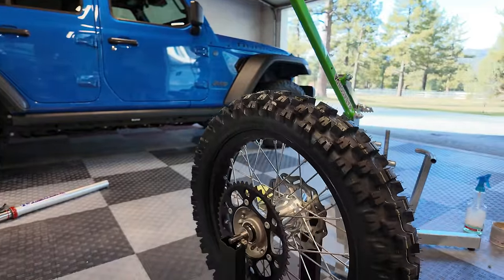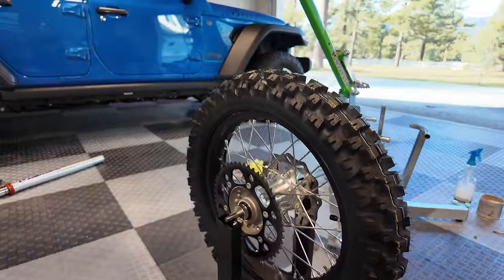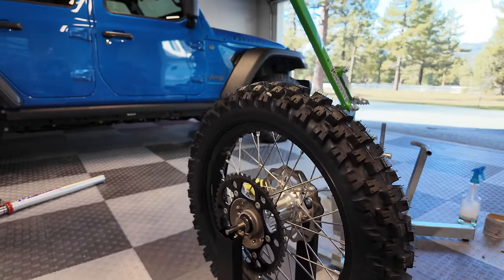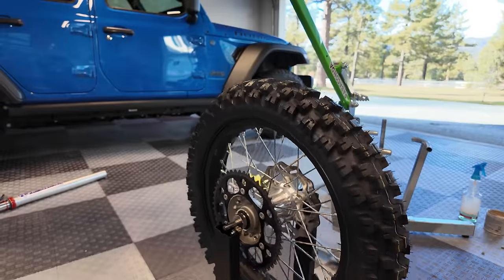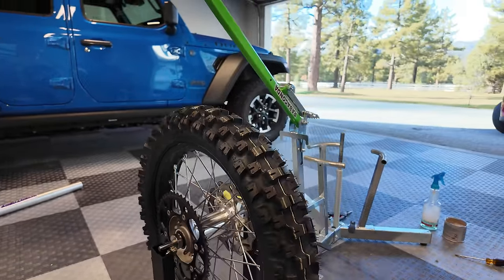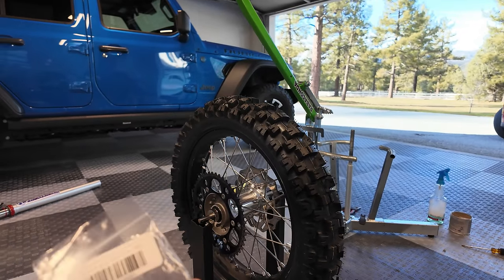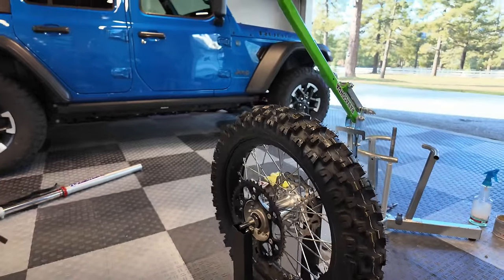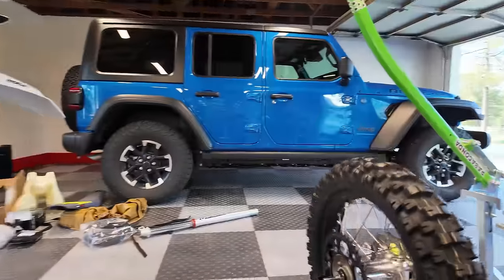I've got my assembly here on my Tusk balancing stand, which I'll also link below. I use this a lot. And you can see how out of balance that is. Look how much that thing is swaying back and forth. So the rim lock throws the balance of the wheel way, way off, and it's going to give you a lot of vibration on the road. So after I was done changing with the Rabaconda, I'm going to go ahead and balance out with these cool Takamoto rim locks. And then we'll get the thing back on the bike, and then we'll have the rear end of the bike buttoned back up.